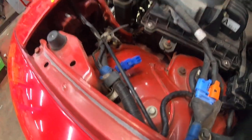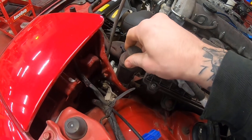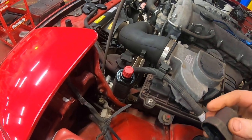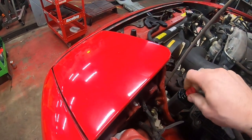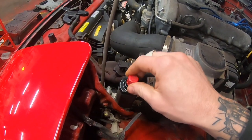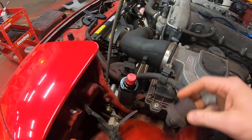There's not much behind the headlight. You've got the motor itself for the headlight, and it does have a manual adjustment. If you need to move it up or down, or if it's not working, you can rotate this and it will raise and lower the headlight. However, if the power's on it will fight against you, so make sure you disconnect the power before you do that.